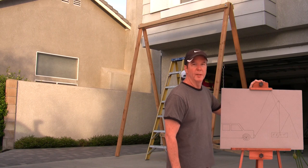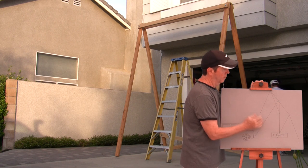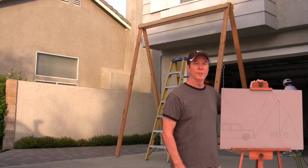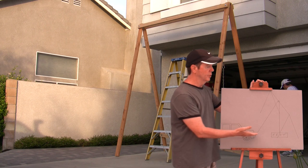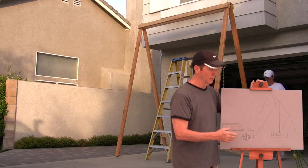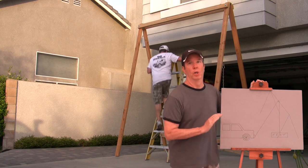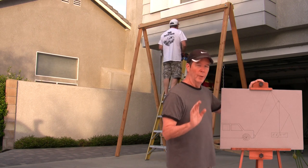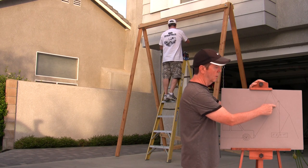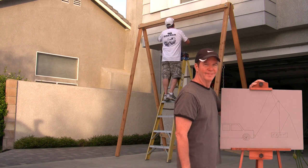Okay, so Rembrandt I'm not. Truck, winch cable, tent, A-frame. It's all there. Now, the first time I set this all up, I assumed that the sheer weight of the tent would be enough to keep the A-frame firmly planted on the ground when I started winching up the tent. Big mistake. Huge. What actually happens is, for whatever reason, the pulley wants to travel along the winch cable back down towards the truck. So does the tower.